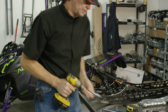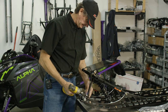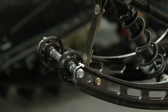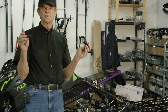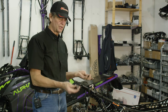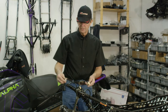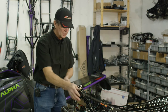This has a lock nut, so you don't need to cinch it really hard because we like it to float a little bit on the shafts. That's the front arm installed. These are your tunnel spacers for the front arm. The width of this arm is perfect for Polaris, but we're going to install this suspension in a Skidoo so it has a shoulder on the tunnel spacers. When mounted in the vehicle, a bolt goes through and attaches the arm to the vehicle. We'll leave them in temporarily.